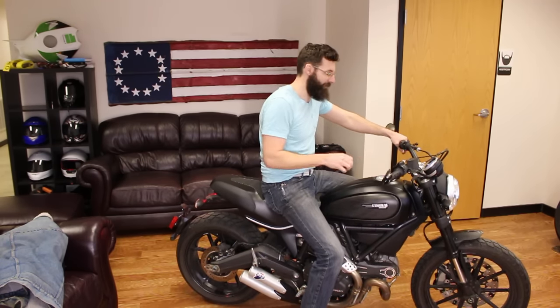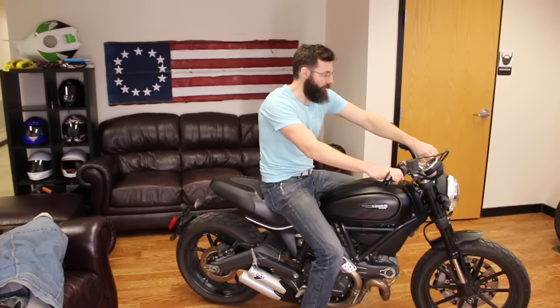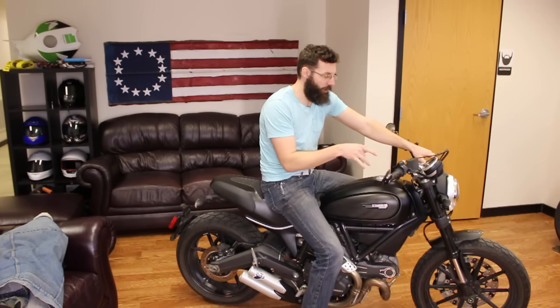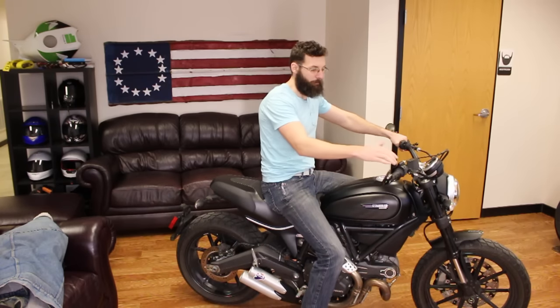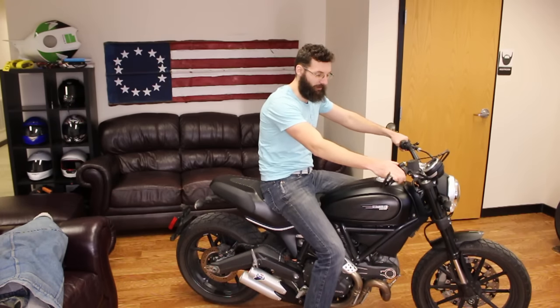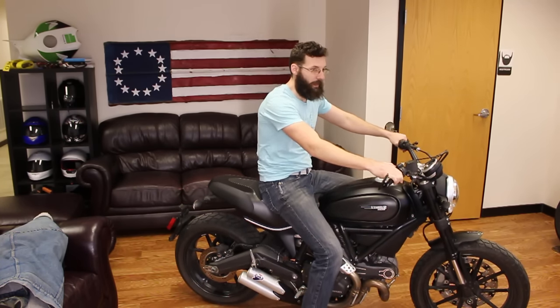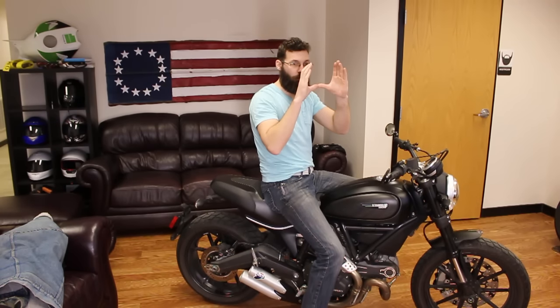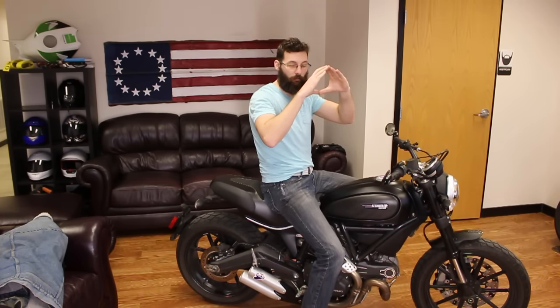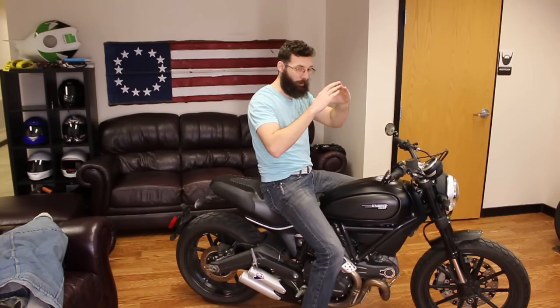In this instance, there are a couple of things you've got to check. Your key's already on, but the first thing is check your kill switch. On the right side of the bike, you've got a little kill switch. On Harleys, it's right next to the starter button. On metric bikes, the kill switch is above the starter button. It's either closed or open loop. If it's closed, that's what you want to run the bike. Open loop is going to stop it. You want it to be closed loop for it to start.